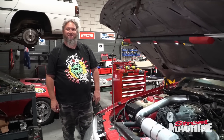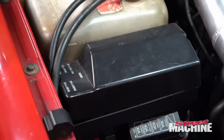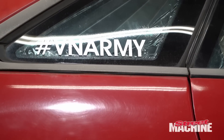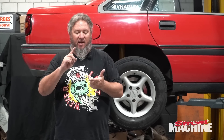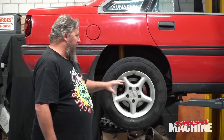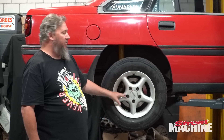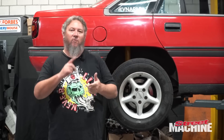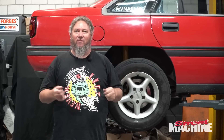Let's look at some burnout tires. The major safety items when it comes to burnouts are battery location — make sure it's positively located, which ours is — radiator overflow, tail shaft loop, and then wheels. They don't like you using alloy wheels; they like steel wheels with the wheel weights removed. You can't have wheel weights because at high RPM the wheel weights go off into the crowd, and no one wants that.